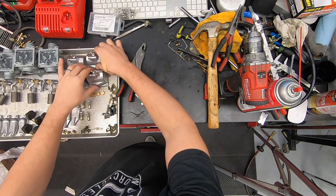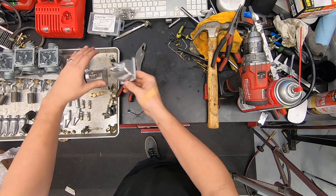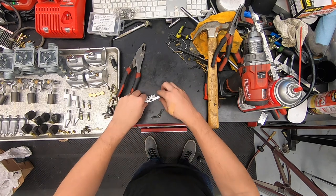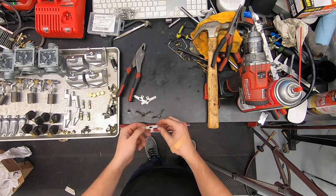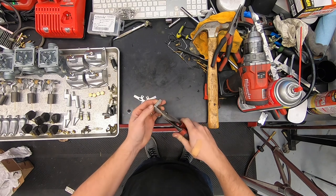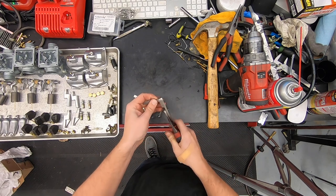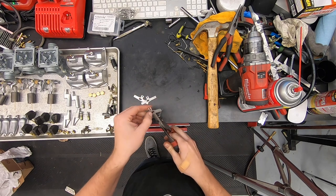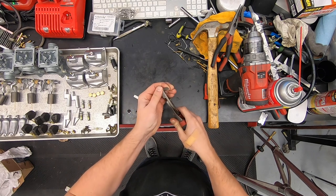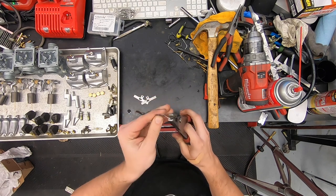All the pieces are cleaned up. I went ahead and dry blasted one of the bowls so they'd have a very similar finish — I think those turned out great. Now I'm moving on to making the jet holders and I figured I'd show you guys the process — it's pretty quick and easy. I take a flat blank, grab it in the spots I want to keep flat, and then just bend it up by hand, matching the angles on each end.